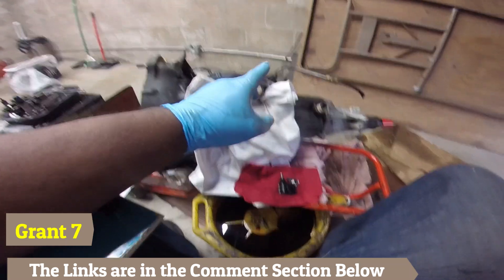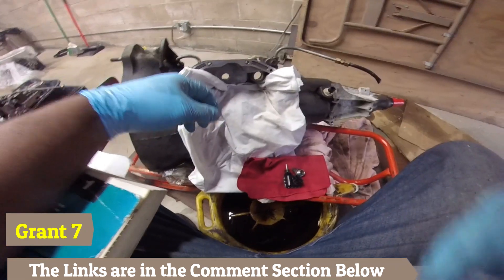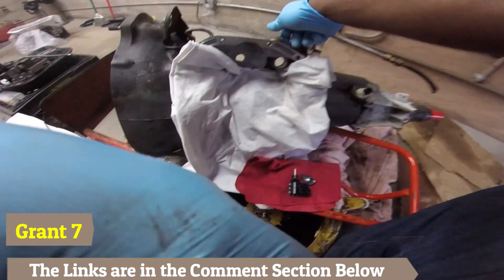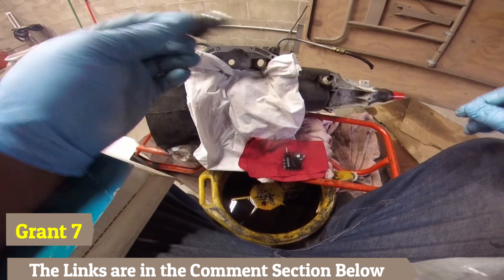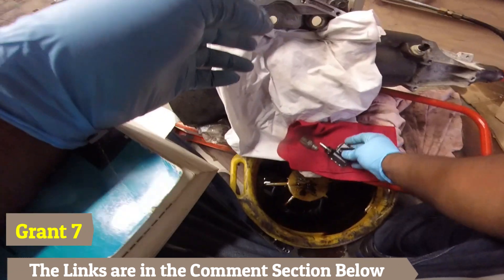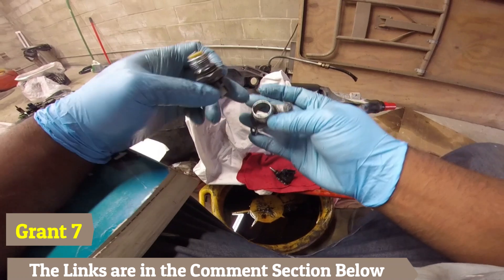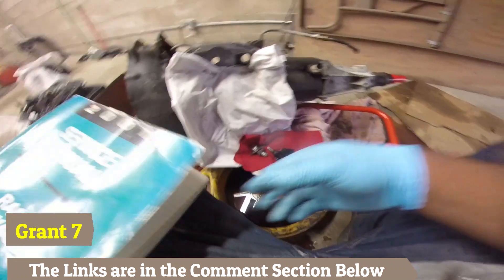The reason I'm drilling is because we are upgrading this 46RE to go into my 2001 Dodge van. The difference is this transmission — from 2000 and some older years — came with the old-style safety neutral switch, which has three pins. But the 2001 uses a style with five pins. It does not fit directly into the case; this new one gets threaded in. The hole sizes are different, so we have to drill the case in order to get it to fit.